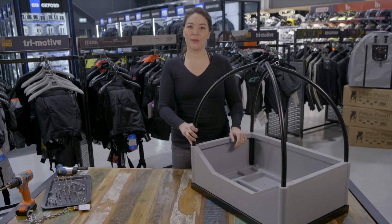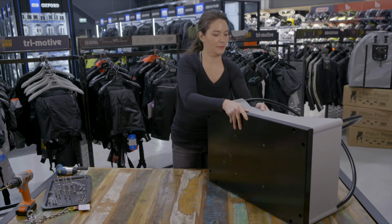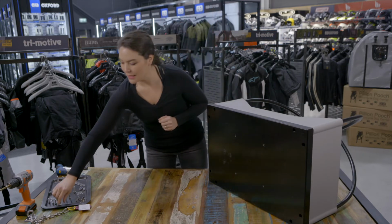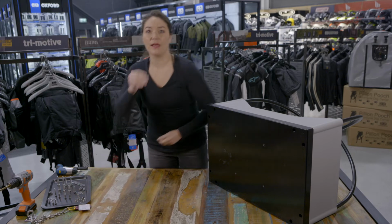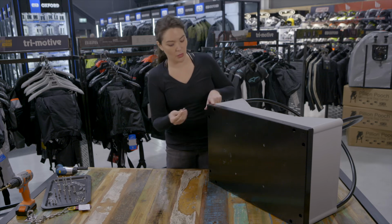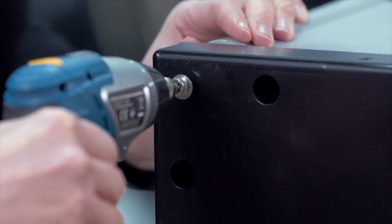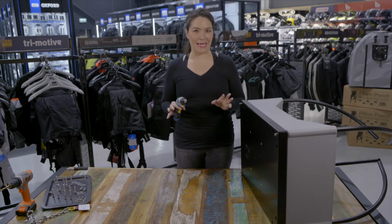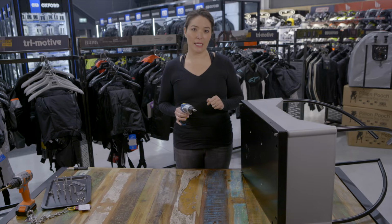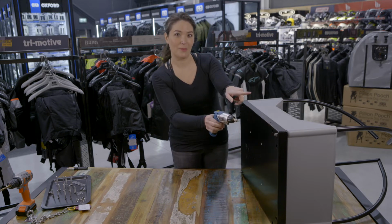You can then pop the Pillion Pooch onto its back again. Take the 20mm M6 screw, and with the Form C washer on the screw, screw into the bottom of the roll bar to hold them in place. Again, don't fully tighten yet. Now that we have the roll bars in, we can tighten up the 8 screws that attach the base to the plastic tub.